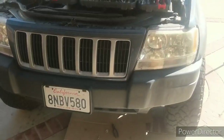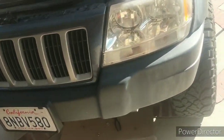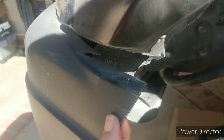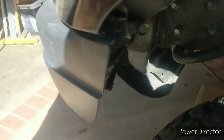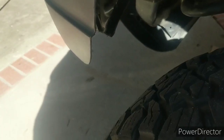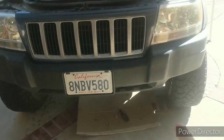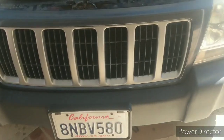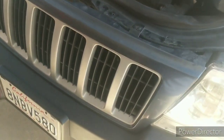The first thing you're going to want to do is get your bumper off. I've never taken my bumper cover off before, but mine's trimmed so I only had one tech screw here. Normally there's a bolt here, a wheel liner, and push pins. Down below there are push pins as well.